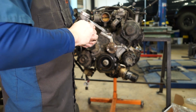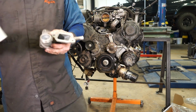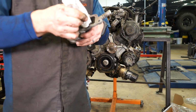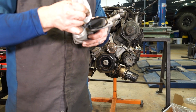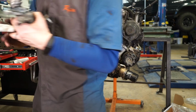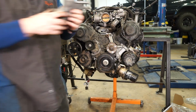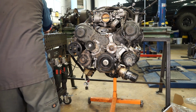Depending on what year your truck is, there's technically two different sealers. The early trucks use the older FIPG gasket maker. The newer trucks that take the pink coolant take a really expensive gasket maker that's in a green tube. So make sure you're using the proper sealer.